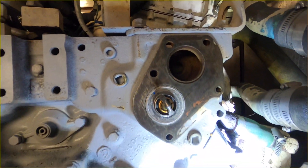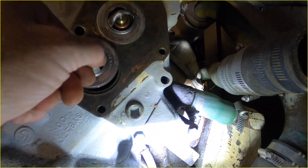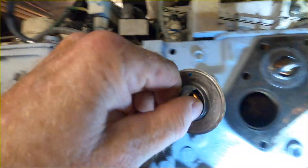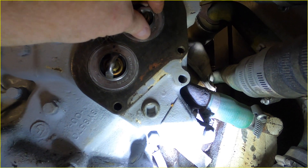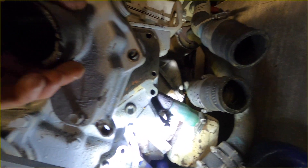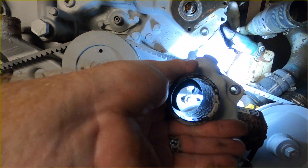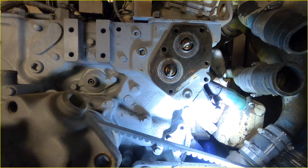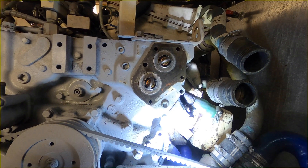You've got your two thermostat holes, and you'll see there are rings where the thermostats are gonna sit. Make sure they stay there — each thermostat sits right in here nicely and you just press them in so they sit there. You don't want them to slip. Then you put your housing on and tighten it up. Test it by putting water through this hole right here while it's on and see if it's dripping out of the bottom — that way you know before you put the whole heat exchanger back on that you don't have any leaks.